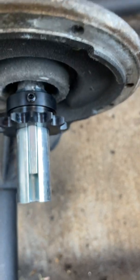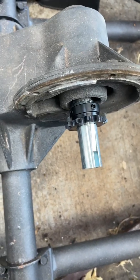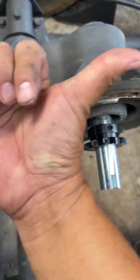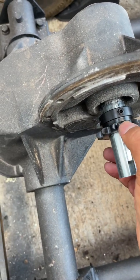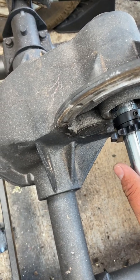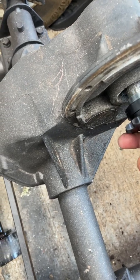If you like this, hit the like button and hit subscribe. I'll be doing more videos on this 2006 Yamaha golf cart. A lot of people have questions about the shaft — this is an electric rear shaft. It spins this way toward the front to go forward. This is a number 40 chain setup, and the sprocket is 12-tooth. The bore is one inch on the outside.